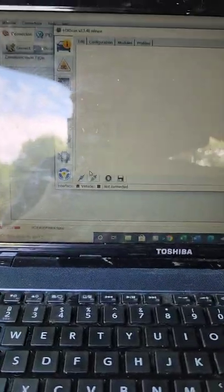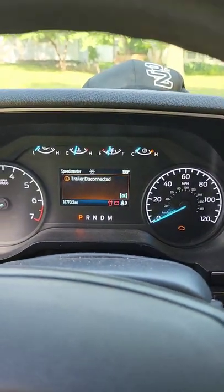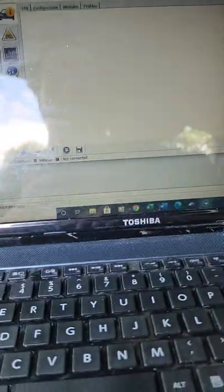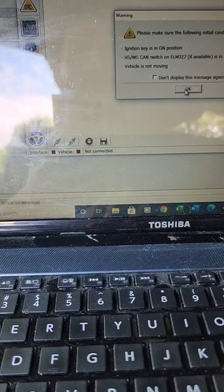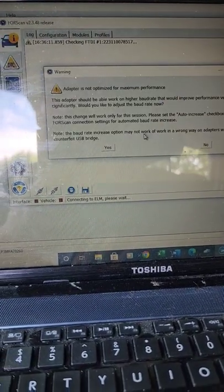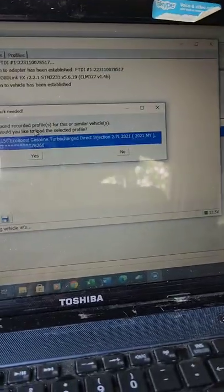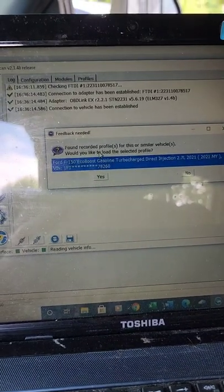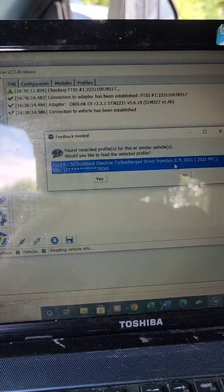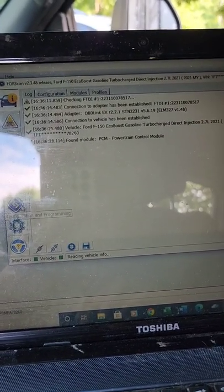We're back. I totally disconnected and trailer brake still worked — I was able to change the gain. Let's go ahead and reconnect. Found recorded profiles — I'm going to say no to loading the saved profile because I want to pull exactly what's on here right now. I think if you load the saved profile it's going to be your base info.